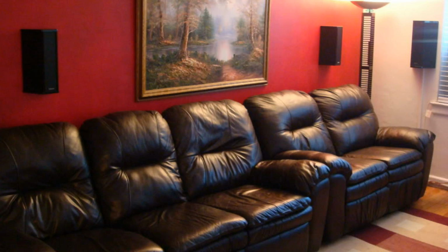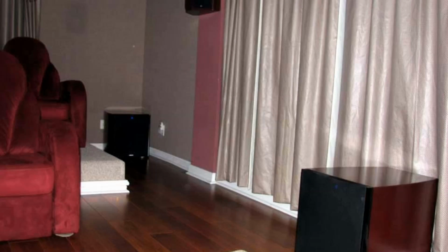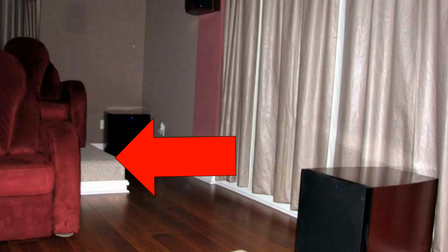So you really want the couches or the theater seats as close to the center position of the room, about 1/4 of the way from the back wall. We actually have a little video on that you could look at, and some articles that discuss that. But if you could follow the 1/4 L rule by keeping the couches away from that distance, you'll be doing yourself a lot better, because you'll get better bass and it'll just be better positional EQ for your speakers.